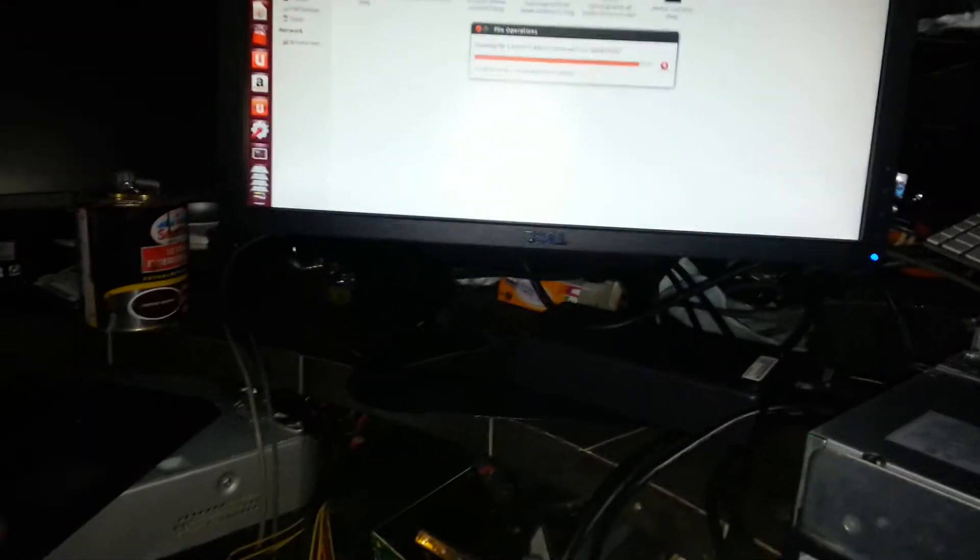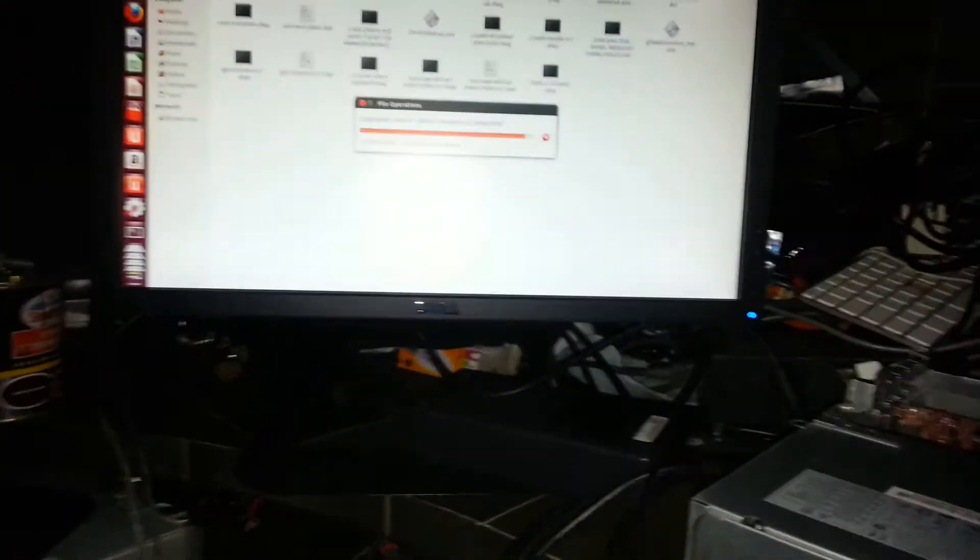All you want to do is just get the files off and then wipe it, because you don't want to mess around with a buggy operating system anyway. So get the files off that you want, wipe it, and then put the files back on again. It's a nice way to get stuff out of a locked Windows machine — live Linux CD.